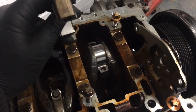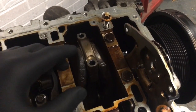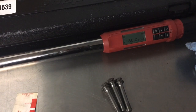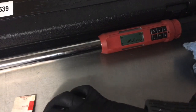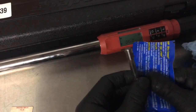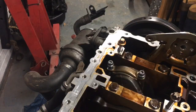It's just as important to make sure that these still go the same way around even when we're doing this, otherwise you won't get the right reading. So we'll put that down there — it'll be gripping it slightly. Then we'll get the new bolts that we're going to be using and torque them to spec, and however far that's squashed will be our clearance. The ARP recommendation is to torque these to 36 foot-pounds, so we've got the torque wrench set to 36 foot-pounds. It also recommends that we use the ARP grease on the head of the bolt and on the threads. So we'll do that now.